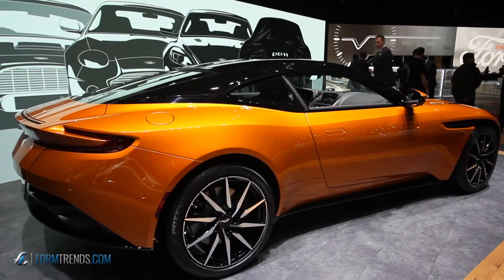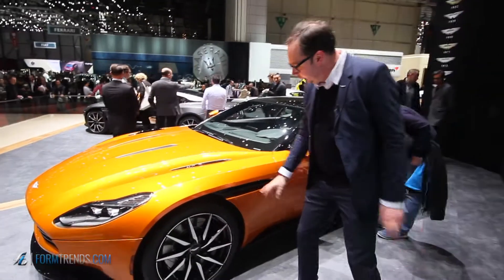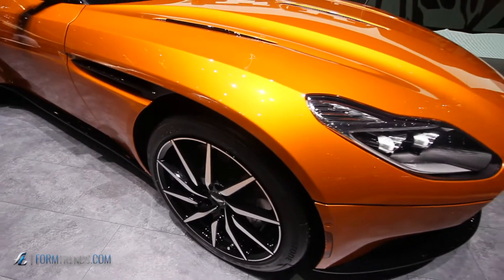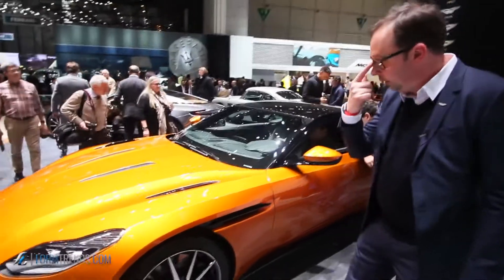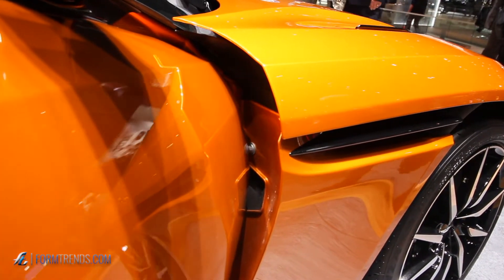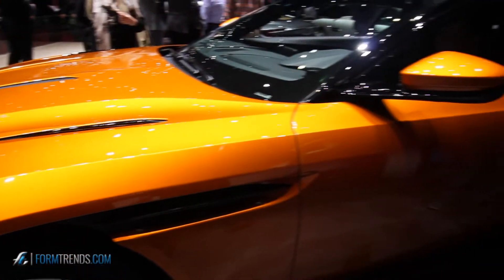On the side of the car, the car has very integrated aerodynamics — it's not a case of sticky plasters like we'd see from five to ten years ago. It's a full system. Starting with the side strake, which is very much reimagined for this car and was inspired by what we did for the CC100, the side strake is actually meeting the wheel arches. The reason it's doing that is we're actually venting pressure off the top of the arch, which increases downforce at the front and reduces drag. Underneath, there's a series of ribs that spiral the air down the side of the car, scrolling air off the bonnet and under the wing mirror. That reduces drag, reduces wind noise, and it all leads to the aero system at the back of the car.